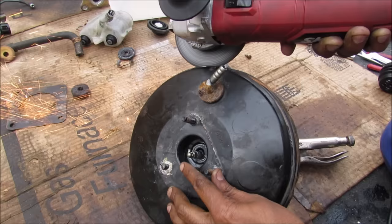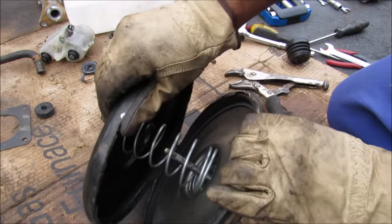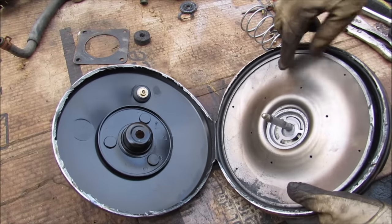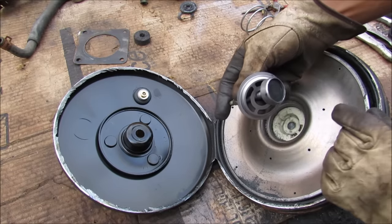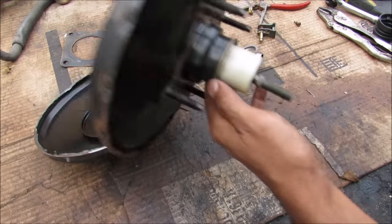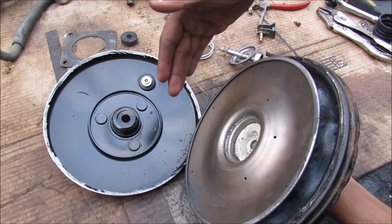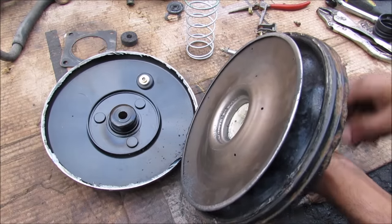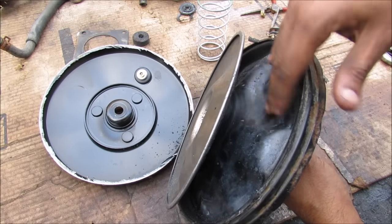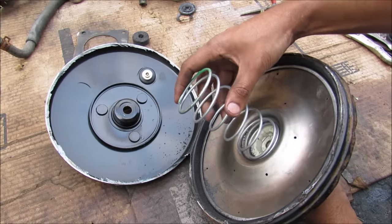Now I'm going to chop open the brake booster to see what's inside. Inside we've got a spring and a little valve that goes out to the vacuum line. There's a giant metal plate with a bunch of little holes in it, and the push rod that will push on the master cylinder. Essentially what we have is a giant diaphragm that can move in and out. The engine vacuum is on one side, and atmospheric air enters the bottom half of the diaphragm when you press the pedal. The pressure difference between the vacuum side and the atmospheric side is what causes the diaphragm to push outward, giving you that power assist. This giant spring acts as your return when you release your foot, pushing the diaphragm back down.